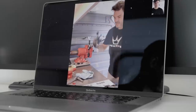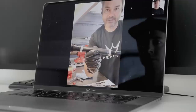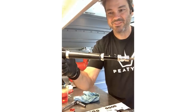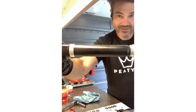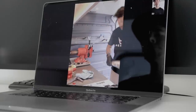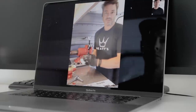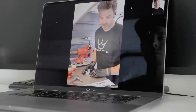This is a live valve damper out of a 32 fork, and this thing has a rubber bladder, similar to a lot of dampers. What you'll see is when you push this shaft in, that bladder grows. So that's essentially an IFP — you can see it's kind of flat there, and then when I compress it completely, it's round. Pretty much every form of hydraulic suspension has some type of IFP. Our Grip suspension does it similar to a shock, and some other fork dampers do it with the rubber bladder. But all of our high-end stuff does it very similar to our shocks now.